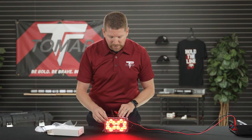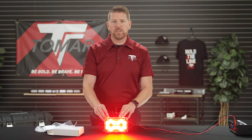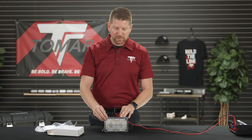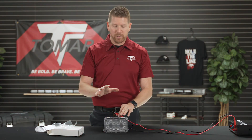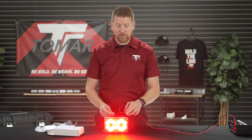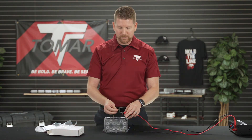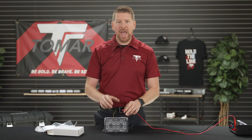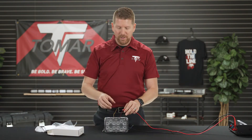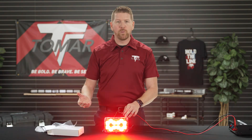Now it's telling us what the red wire is currently programmed to, displaying that on there. On this particular pre-programmed lamp these are set to a 75 flash per minute Neob flash which is 50-state legal and meets California Title 13 for flash rates — this is how we typically put these standard out of the box. Now if I wanted to speed up or decrease the rate of flashing I'm going to tap the yellow wire. You'll notice that the pattern of the entire field has still remained the same but the lamp is flashing faster. If we want to go back we just double tap the yellow and now we're back to where we were.